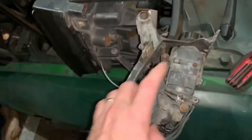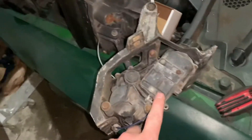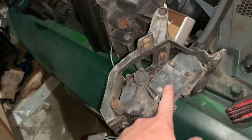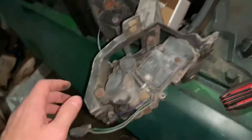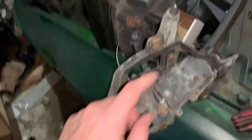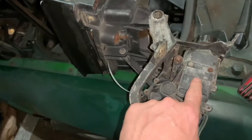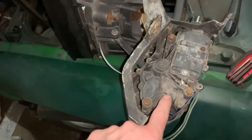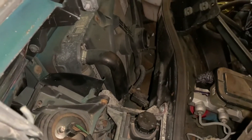So in my travels I picked up some Fiero popup headlight motors. I'm going to take those apart and try to get them working. This is one of the new ones — it's mounted in here. This one will go down but it won't go up, which leads me to think it might be an electrical issue. We're going to pull this one apart in a future episode. Also we've got to figure out why the radiator fan isn't working — I think it might just be a blown fuse.